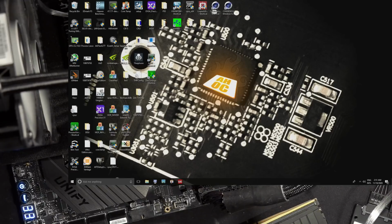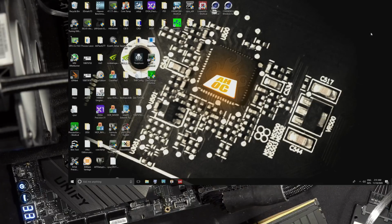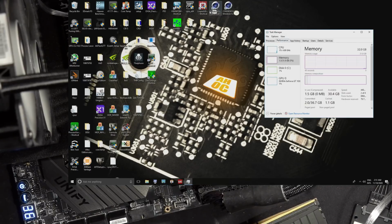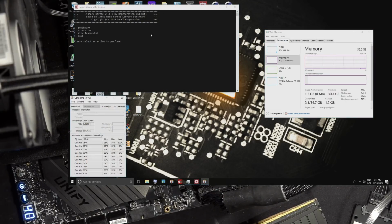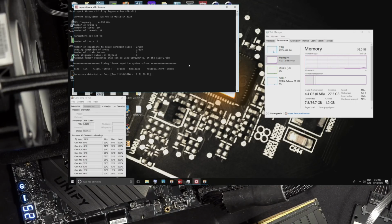Mostly because I've manually set all the timings. Because if you leave it on auto, the motherboard can sometimes do things for compatibility reasons for various memory sticks, based on which memory sticks you have, and a lot of that is just changing the subtimings, and that can skew the performance testing. And the main point of this is to show you single rank versus dual rank running the same settings. In reality, they don't behave the same in terms of overclocking.